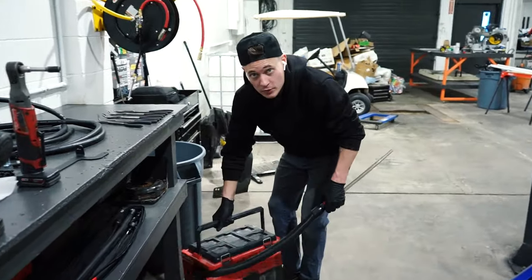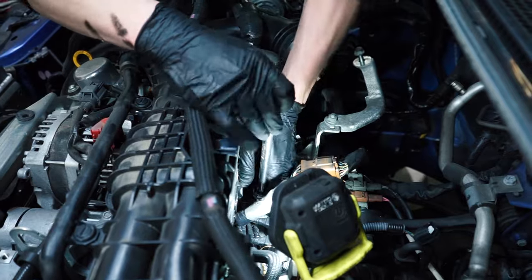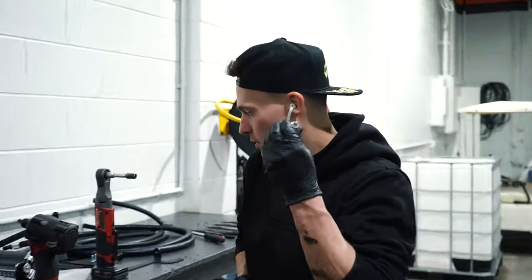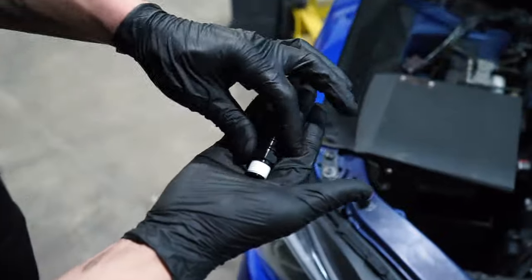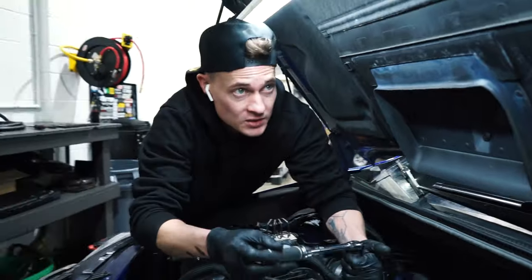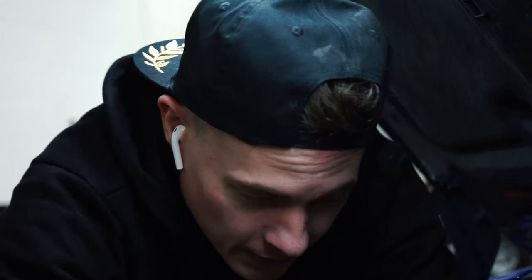Milwaukee, looking for a sponsorship. You've got to remove this — it's just the PCB. That's hot. I tried to blow it — this video has stiff things, screwing things, wobbly things, sucking things, and blowing things. Save this for the customer. Look at this nice brand-new one — put that in there. There's probably a torque spec; I'm going to check because torque specs are important. Now we want to listen for a click. If it just keeps turning without a click, stop and double-check. Click — one for good measure.